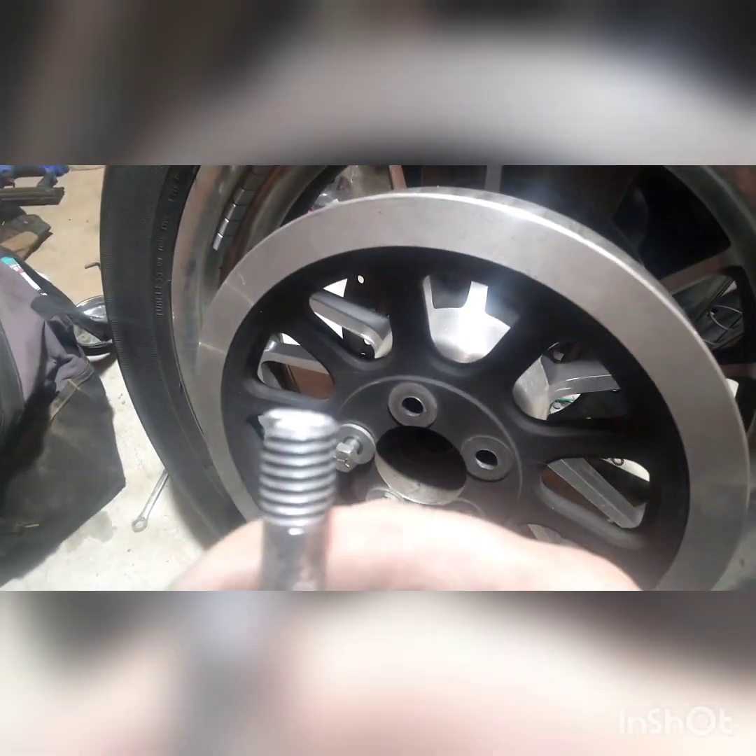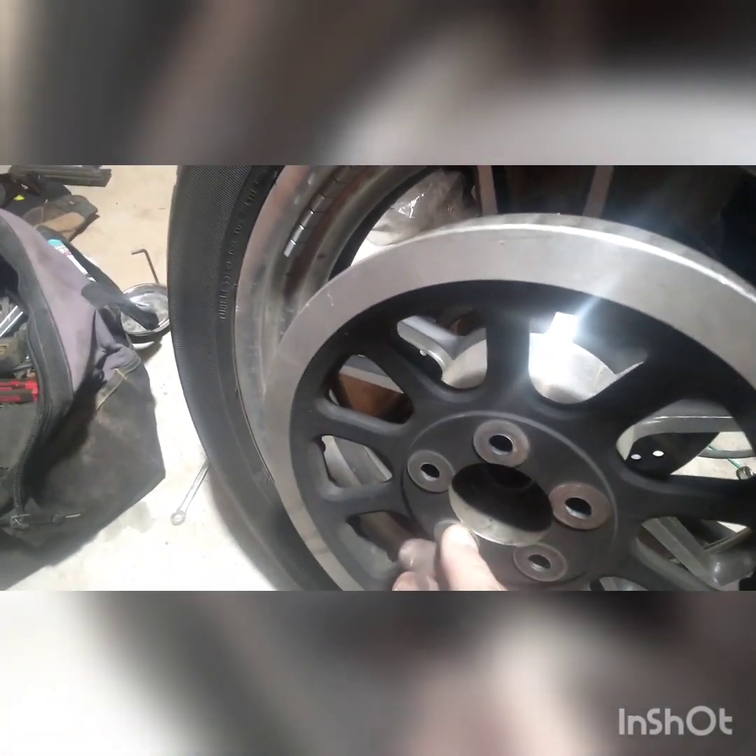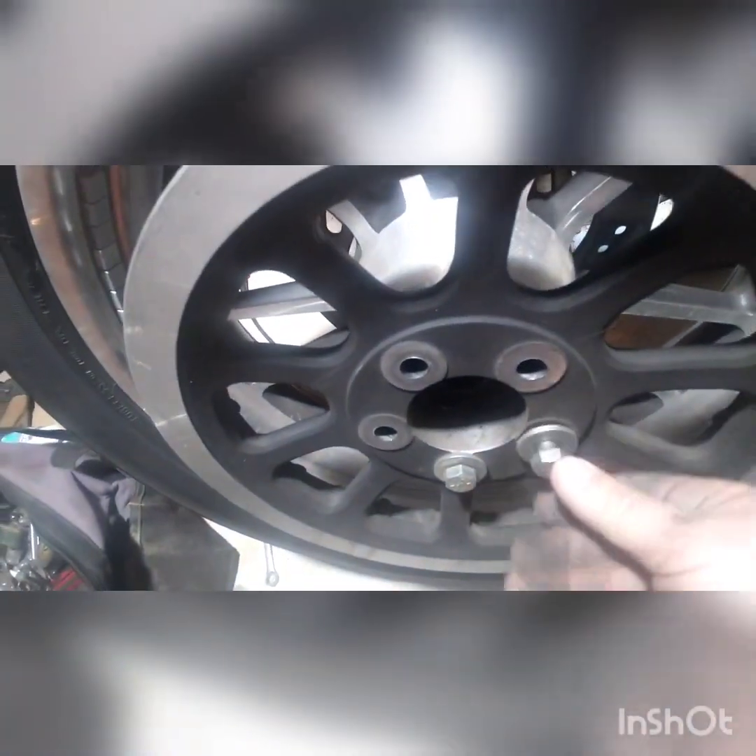So I got the wheel out. As I pulled these bolts out I found another one that sheared off — that was definitely why this one came loose. And look at that, that one sheared off too. Oh, that one's got threads — we would have made it home no problem. What was happening is these backed out first, and then as they came around they'd hit the swing arm doing 80-90 miles an hour and just shear the bolt off. The piece was spinning around, backed out enough, and sheared right off.